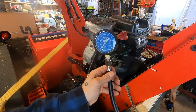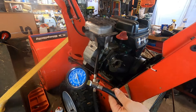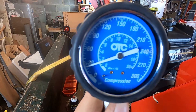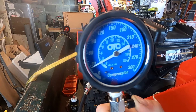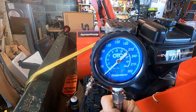I decided to pull out the old compression tester. When you bump the electric starter, you can see that little uptick at the end — almost made me think the compression release was stuck open and that's it closing. You can get it up to 60 when you crank her over by hand, but still not enough to get anything going. So I'm going to tear open the top end.